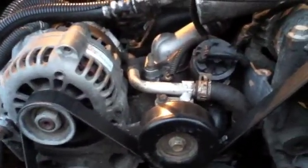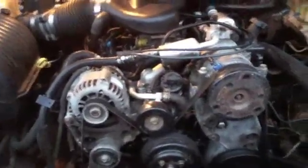You have to take off just about everything you see — air conditioner, air intake, all the wiring, which is the biggest pain in the ass to unclip. You have to take off the power steering pulley again and the AC bracket. You don't have to take the water pump off, but we did because we redid it anyway. You have to take both valve covers off to get a nice good fit when you're putting it on. I'm mainly just making this clip to sum up that my truck is fixed and it's not what I thought. If you have any questions about the intake manifold and putting a new one on, I can answer those.